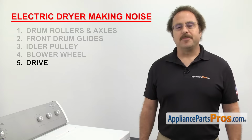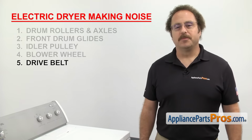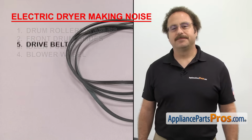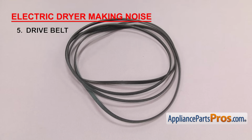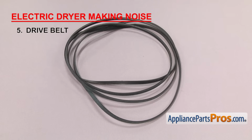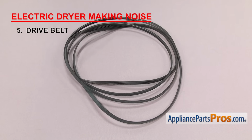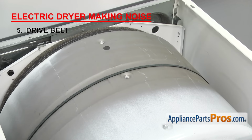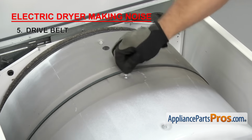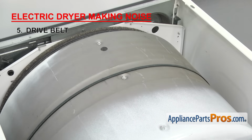Now we need to check the drive belt. The drive belt links the drum to the motor pulley so it turns. The drive belt is a long multi-groove belt that goes around the drum and the pulleys. Usually it just breaks, but if it's starting to deteriorate and pieces are falling off of it, it may make a thumping noise as it goes through the pulleys. Once you have the dryer apart, you can inspect the belt. If it's damaged, you'll need to replace it.